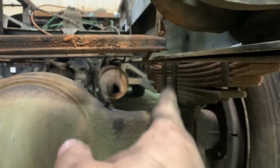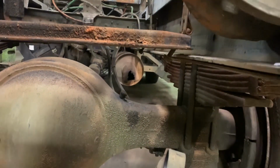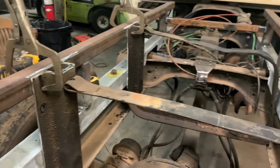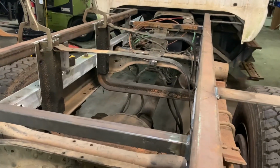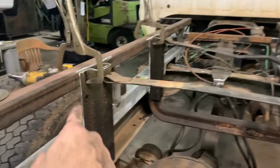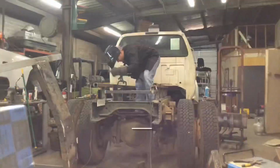Depending on how low that hangs whenever it's got a full tank in it, I may actually come back and weld that in, but that sits just over this lip. So I could shim it, I could make a bracket for it. That I'm not really sure of. That one I'm gonna check in the 4th quarter. But as far as this goes, that bracket's gonna fit nicely, and then I'll just have a medium fight there trying to get those straps buckled in once the actual tank's sitting in it. But I think it's gonna work. Probably the wise thing to do is I'll lightly tack that, pull the straps loose and set the tank in it just to make sure that I'm not completely cutting myself off at the knees.